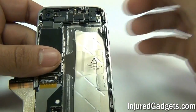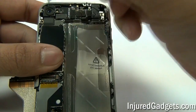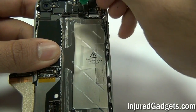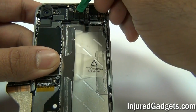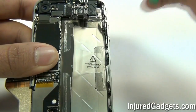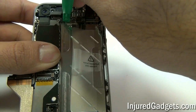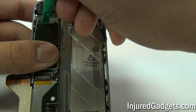With the metal shield removed, you can go ahead and disconnect the six flex cable ribbons as shown here. One is the camera flex cable ribbon. Please note the three on this side will flip downwards. The two in the middle are your touch screen glass and LCD ribbons — those flip upwards. Your camera flex cable ribbon also flips upwards, and once that is removed the camera should pop right off.